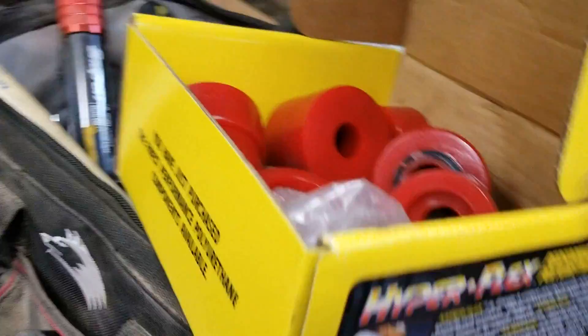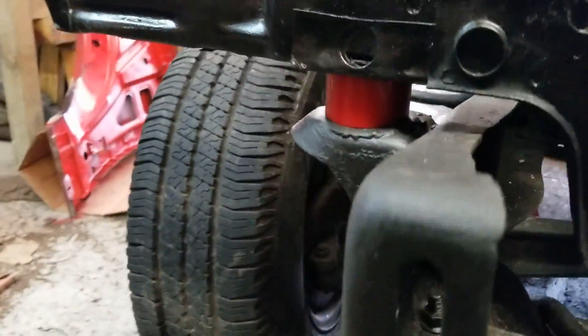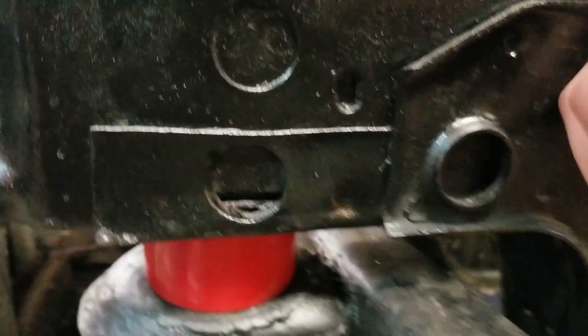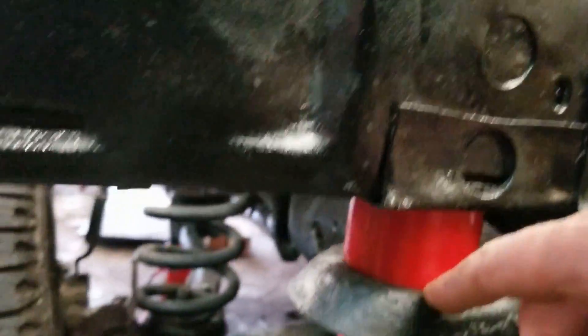Got the front end back on. I got this full mount kit, thinking I absolutely needed to replace everything, but finally I just had to replace these. I actually had to get a step drill to widen this hole because they had welded on a washer — the way it was on before really didn't work. In order to get this to fit perfectly, I had to widen out that hole. Once that was done, this went on just fine.